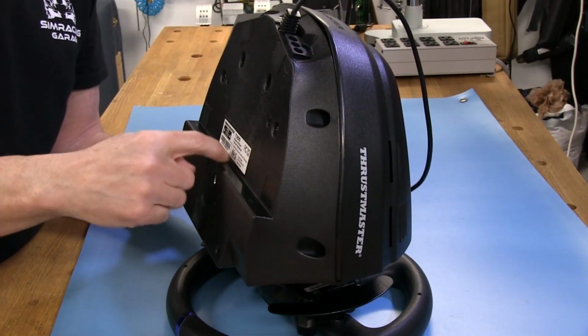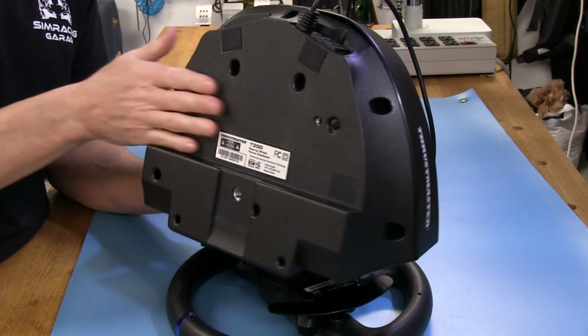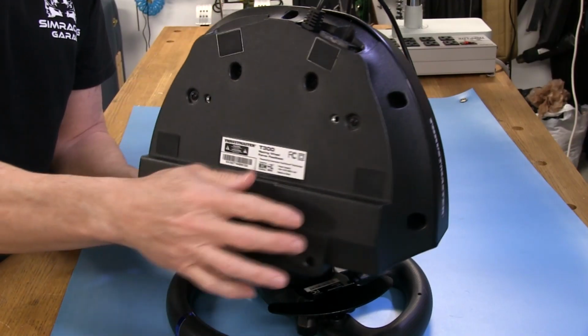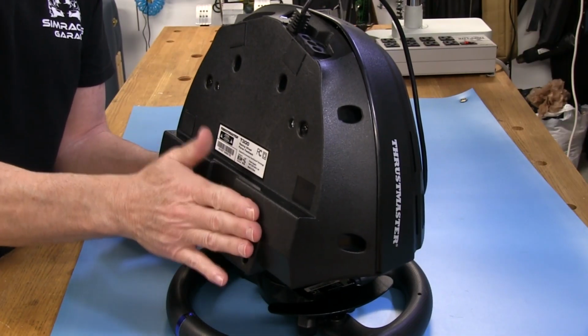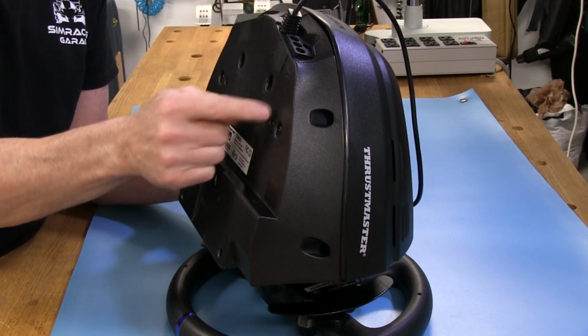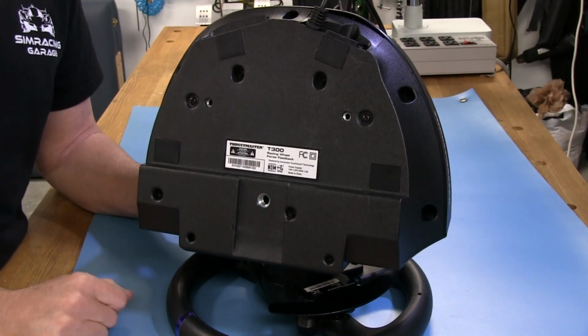This obviously is supposed to bump up against the desk. But if you find yourself a piece of wood or whatever, metal, it doesn't matter, that will go flat across this and be the same width as this, or pretty close to the same width. So in other words, now we've got this thickness going all the way back to where these 6 millimeter screws are. You don't have to go all the way back. Drill yourself a couple of holes in there to run your 6 millimeter bolts.